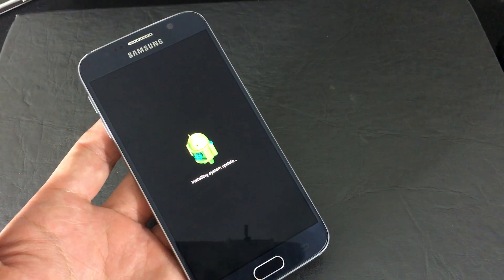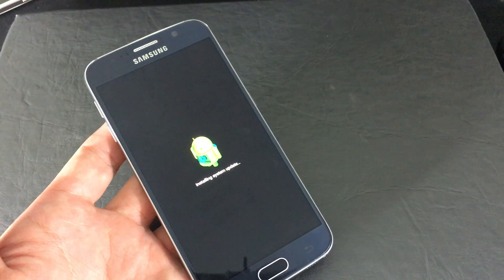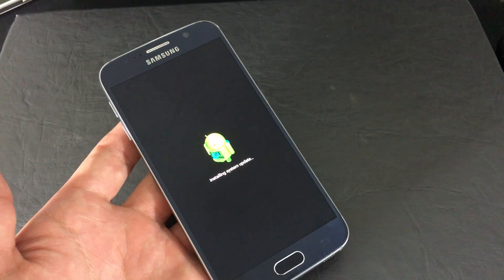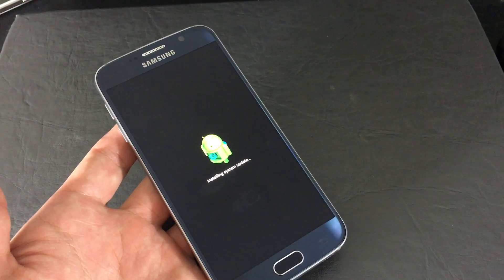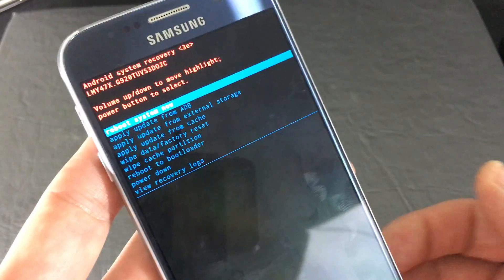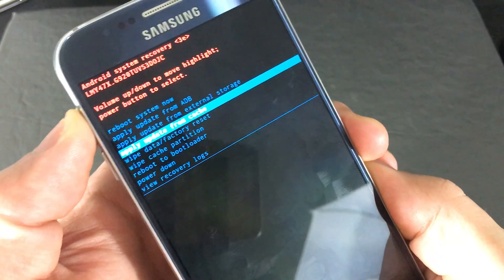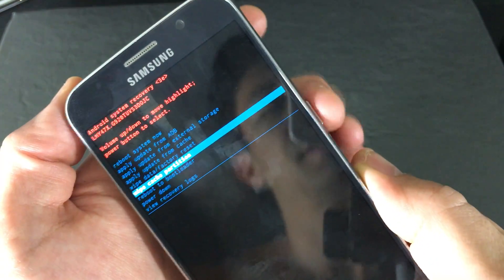Give it a second. And another thing too — if you're wiping the cache partition, it can also help if your phone is lagging, especially if the screen is acting sluggish, if you're having other errors, or even if you're having a lot of battery drain issues. Wiping the cache partition can help your phone instantaneously. So once you're here, go down to where it says Wipe Cache Partition. To scroll down, tap the Volume Down button; to scroll up, tap the Volume Up button. Select Wipe Cache Partition and press the Power button to confirm.